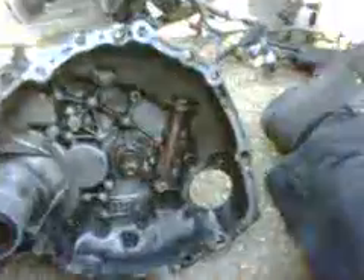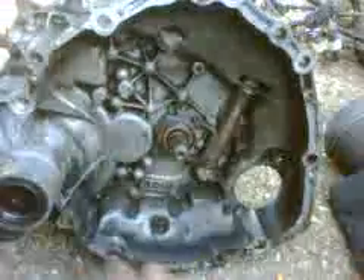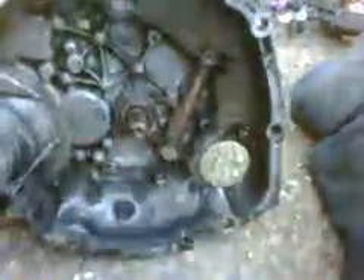The next step would be to try and look at the bolt pattern here. We're looking at having to recreate this bell housing and redo the holes. Some of them are threaded, as you can see, and some of them are clearance holes. There's quite a bit of metal — it's not as big as some of the ones we've played around with before. Basically, try and recreate that bit there, line the motor up and get that bolt in as well.